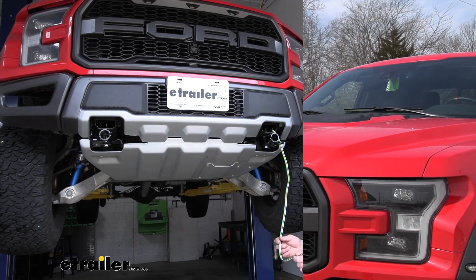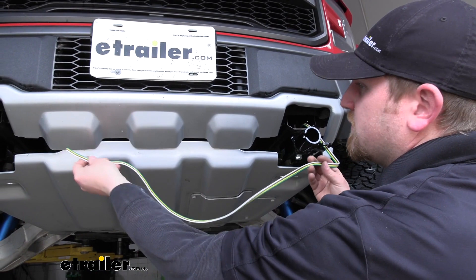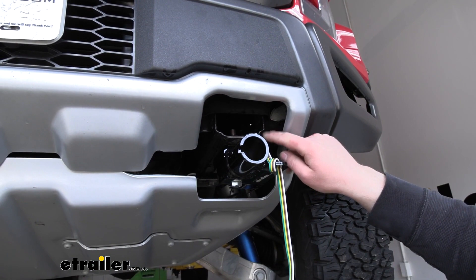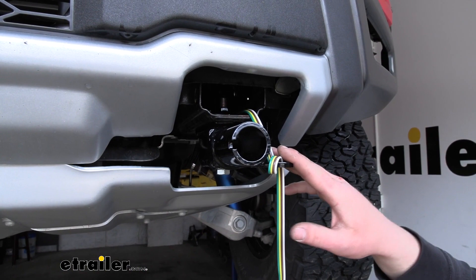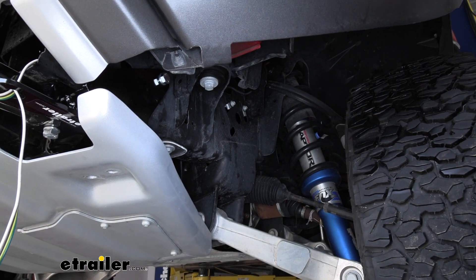To begin our install, we're going to be here at the front of the truck. We're going to take our bundle of wiring and run it from the front to the back. I like to give myself a foot or so up here since I haven't quite figured out where I'm going to mount the plug yet, so I give myself more than enough room. What I actually did was run our wiring in its entirety through the frame rail — it goes into the frame rail here all the way to the back. The way I did that was by using a pull wire.